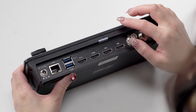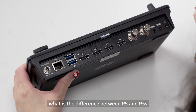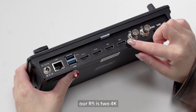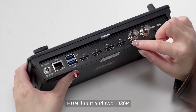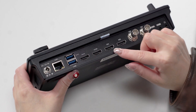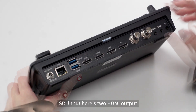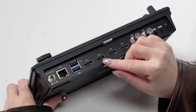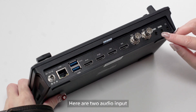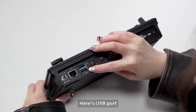This achieves local live streaming, which is a very cool feature. Now, the difference between R5 and R5s: the R5 has two 4K HDMI inputs and two 1080p HDMI inputs, while the R5s has two 4K HDMI inputs and two 1080p SDI inputs. There are two HDMI outputs — one is program and one is multi-view for monitoring. There are also two audio inputs and one headphone output for real-time monitoring.